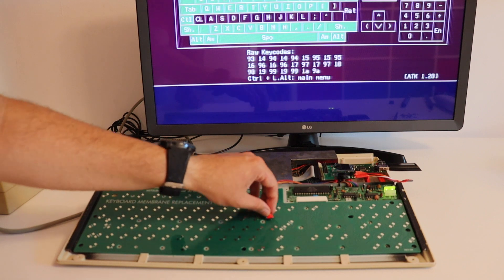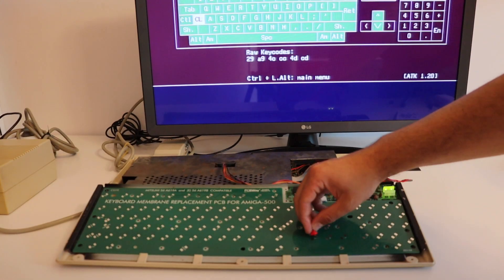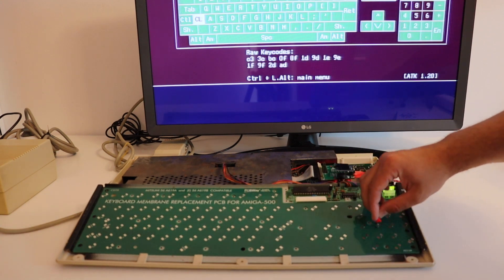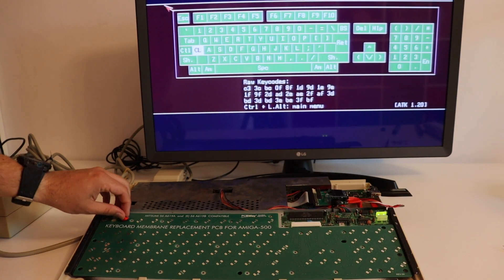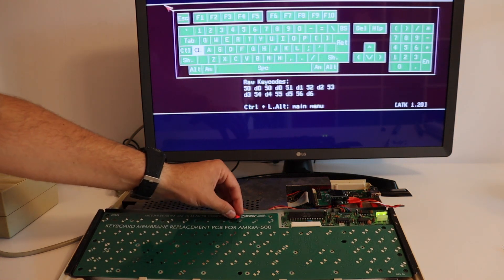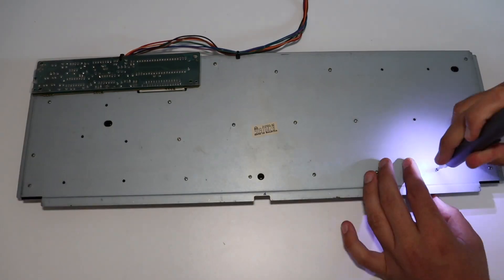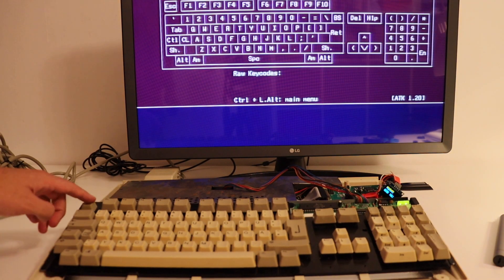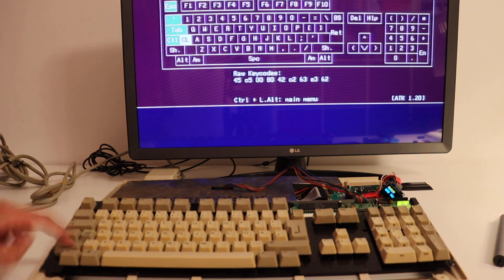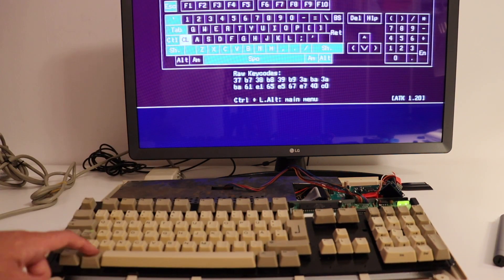Here I have to make a very important note: sometimes the membrane is actually not broken but the conductivity is not good enough. You may use a 4B pencil to increase the conductivity and repair the membrane without replacing it. All initial tests are okay so I can assemble the keyboard again.